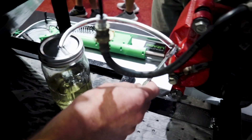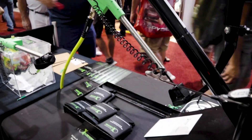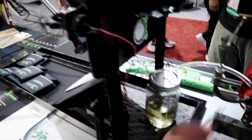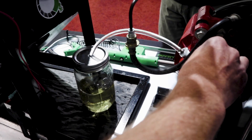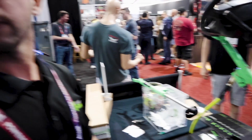You depress the T-fob once, it pushes and holds. Then you go over to your brake bleeder, crack it open, it pushes the fluid out, close it, push it again, and repeat the process. Come back to your bleeder and it continues to push while you're doing that, then release it again.